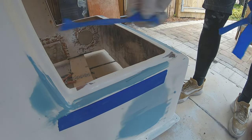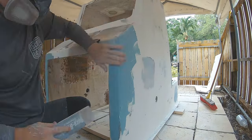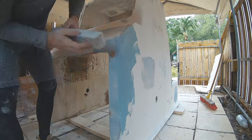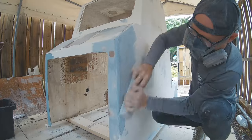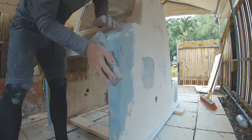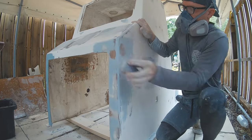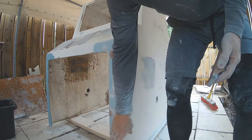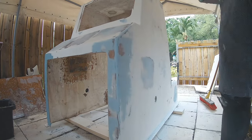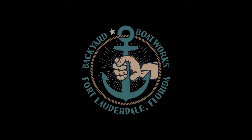You can see here the tape made for a nice clean filler application. Then I moved on to more block sanding — there were several hours of block sanding and filler, more sanding and block filler — but the repairs came out pretty smooth. Then I moved on to shooting some primer. The customer just wanted it in primer and was going to do the paint on his own. All the repairs came out pretty good. If I missed anything or you have details you're not sure about, just leave a comment down below and I'll try to respond as best I can. Thanks guys, see you in the next one.